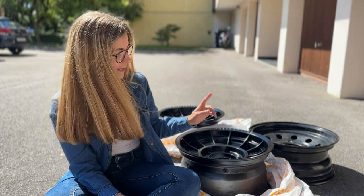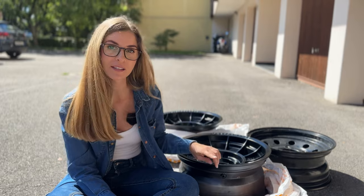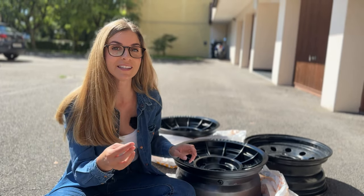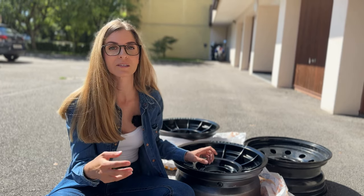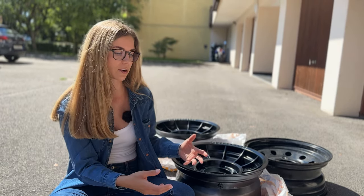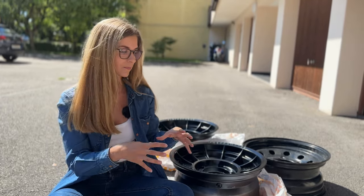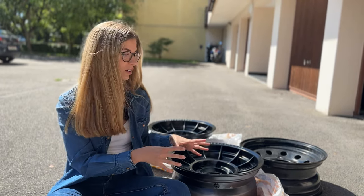The next disadvantage we read about, which seems more possible, is that when deflating the tires the small marbles can go into the inflation valve hole and get stuck. If you've experienced this, please let us know in the comments. This is something we'll have to test, as this balancing type might be great for tires that stay inflated but possibly not ideal for 4x4s that frequently deflate and inflate.